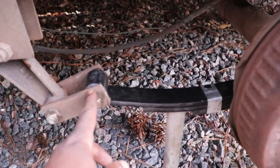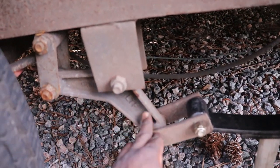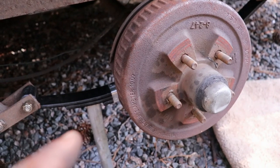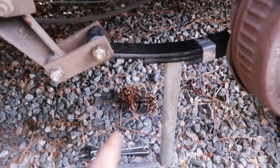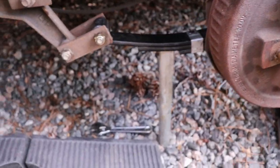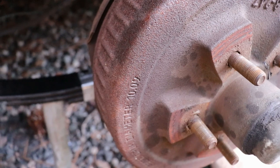Another tip to get this bolt in — you have to release some of the pressure from the shackle swing. What I had to do was jack this side up. But remember, your axle is still not connected to anything yet, so I used a pipe just to hold it up and hold it in place while I use my jack. If you don't have two jacks, use a jack stand or something like that. Got everything secured, now I'm going to tighten the forward bolts on the bottom and I think we should be good.